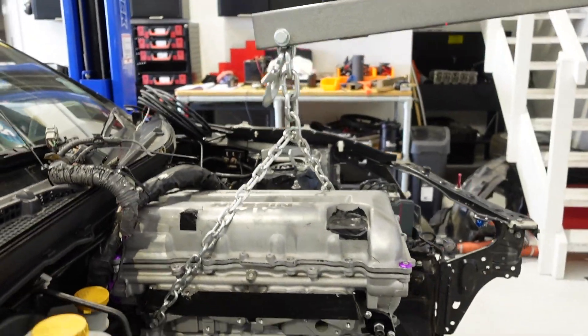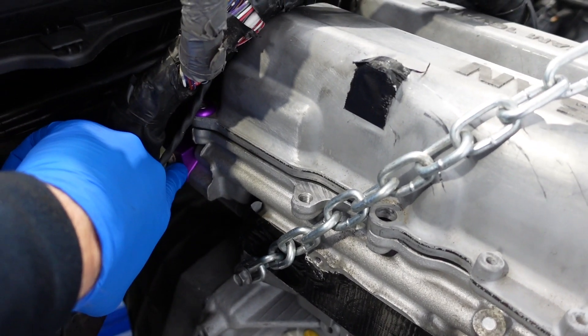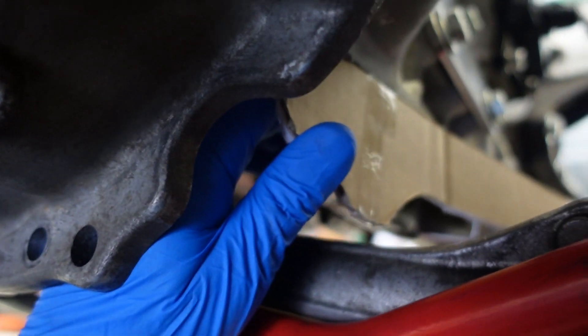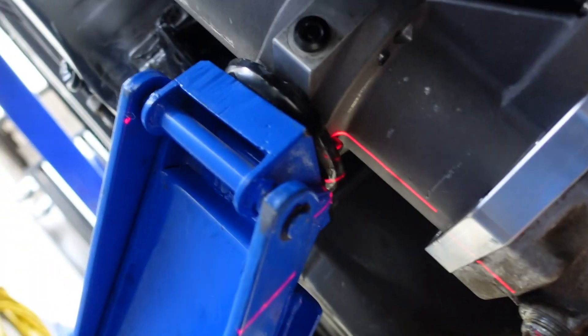As far as aligning the engine in the car, there are a couple of things we need to line up. Engine height is one — we want to make sure we're not sticking it too far into the bonnet. We've decided not to cut the firewall, so the clearance between the firewall and the back of the engine is another limiting factor. You can see the cardboard template showing decent clearance on the steering rack and between the gearbox and the anti-roll bar, while things are getting pretty tight between the firewall and the engine at the top.